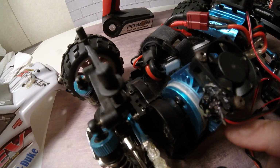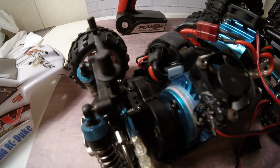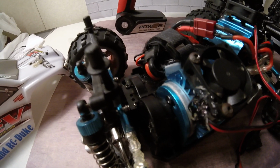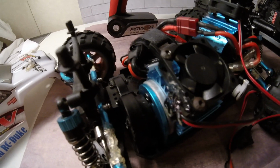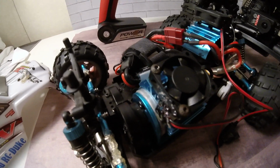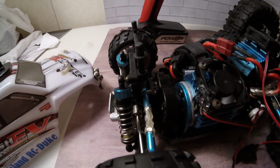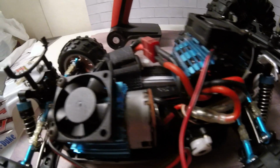Now when you messing with these screws to change the motors out, try to heat up the little screws so they don't pop on you. All I did was take my soldering gun, touch the tip to them, heating them up for a few seconds. They came right off, no problem whatsoever. Make sure you grease everything up good when you put them metal gears in there.